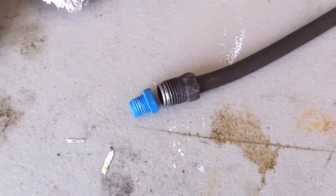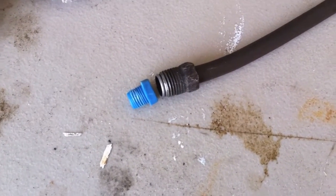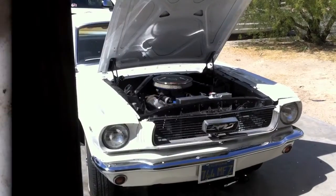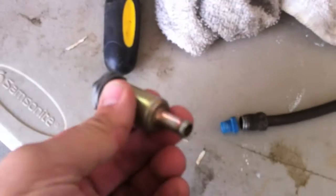We can move forward with getting liquid in and filling it up. I'm going to do a little road trip to AutoZone to get the fittings to connect the transmission cooling lines on the bottom of the radiator. I'm also picking up a fuel filter for the carb. I talked to Scotty — the belt is an inch too long, putting the power steering pump all the way to the end of the adjustment, so I ordered a new belt that'll be here this afternoon.